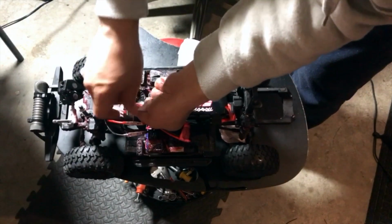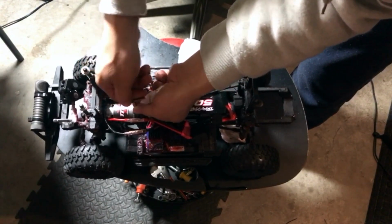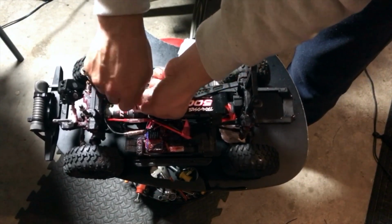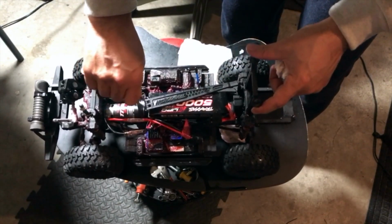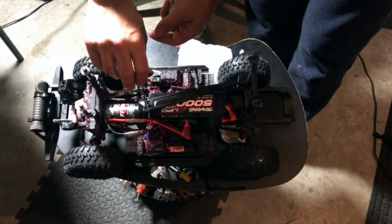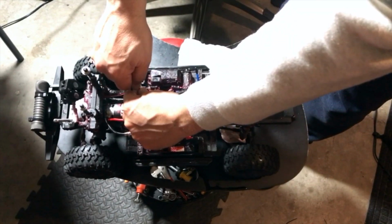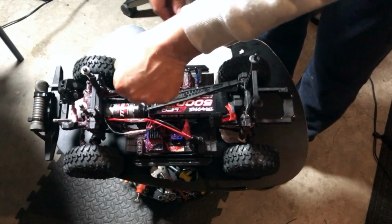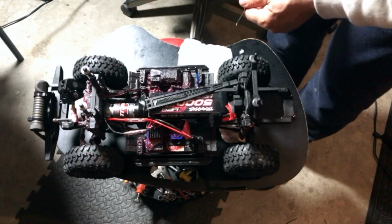Maybe a lot of people whose motors went dead just replace it with another one. It could simply be repaired by spraying some WD-40 as soon as you get back, and just clean it up, because there are brushes inside there, and if the brushes can't make good contact, they won't make a connection, so the motor wouldn't spin. So just have that little bit of understanding, give it a minute, grease him up, lube him down, and the RC will do the job that you need it to do all the time.